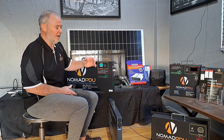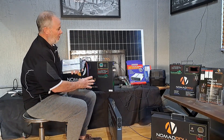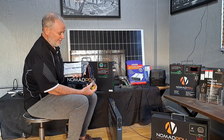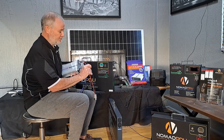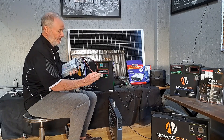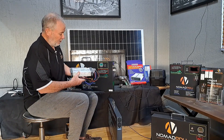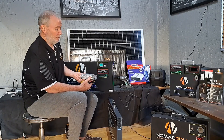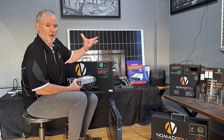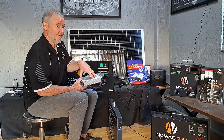The DC-DC charge — you can choose up to 50 amp. These are a Mattson, a brand you would have seen. They've got a solar input, they've got the DC from the vehicle input, and they've also got a wire for a smart alternator that goes back to that. Then you can charge your Nomad LiFePO4. It's got a profile you simply set — once you've set it at LiFePO4 it remembers it, and then as soon as your car's on it'll start charging. When it's off, it'll be off. It's got a built-in VSR and also has a solar input.